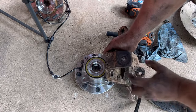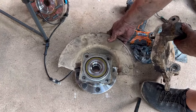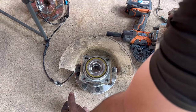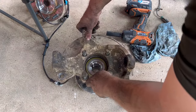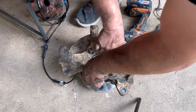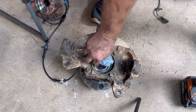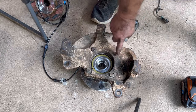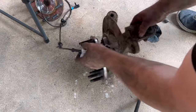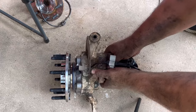The top is where your brake line bolts to the top of this. Your brake shield is always going to go toward the front of the vehicle, because your brake caliper and pad apparatus sits here. Start everything by hand, then let it rip. At this point, look up the torque spec and torque these four bolts. Once you've torqued them, you're going to want to thread this ABS sensor up behind the brake shield.